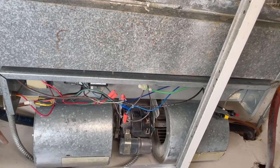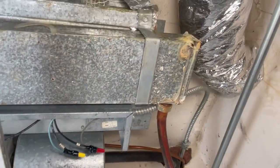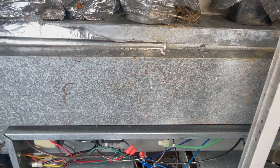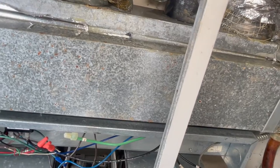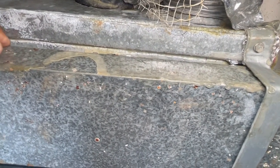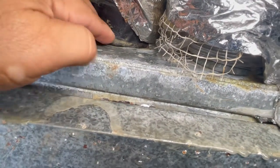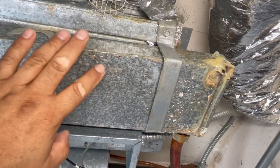The least common problem but a pain in the butt: the coil box has holes at the bottom, and those holes clog before the water reaches the tray. The water is supposed to drain from the coil box through those holes down into the tray. When they get clogged, water pressure builds up, rises, and comes out of the seams and vents, making a real mess. I'm going to remove the tray to show you.